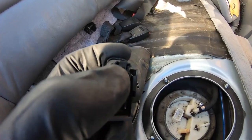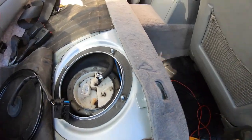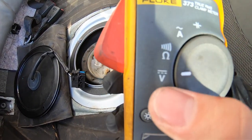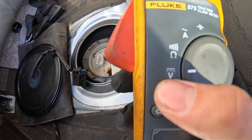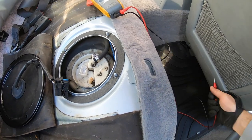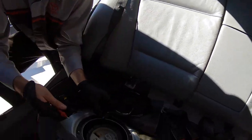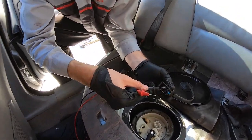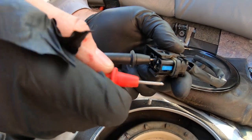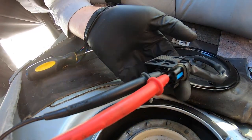We're gonna go ahead and find those two pins right here on our plug. We're gonna take our voltmeter. We're going to stick it to DC volts right there. The V with the little straight line and the dotted line. We're gonna take our two leads. We are going to stick them in the positive and the negative. Now, it doesn't really matter which one. Your meter will just show a negative if the polarity is backwards. So I got those jammed in there.